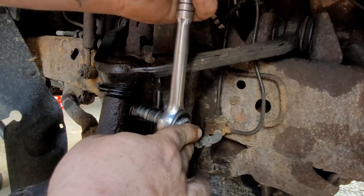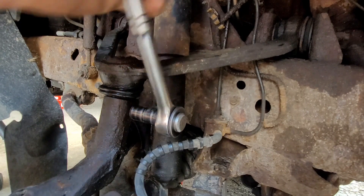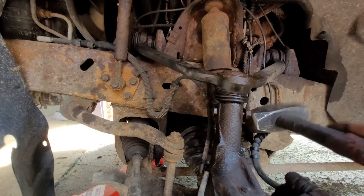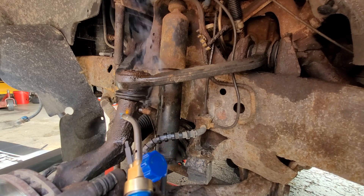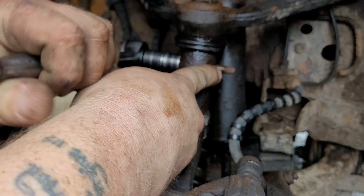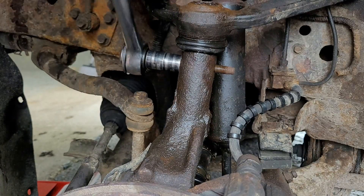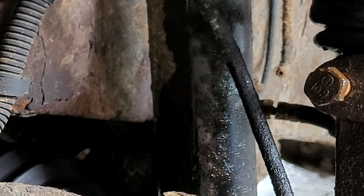We have another job besides the brakes — we're gonna take off the upper control arm. Grab your 15 millimeter socket and break this loose. This is a pinch bolt, so you want to knock that bolt all the way through so we can take off the upper control arm. If it's rusted like this one, sometimes you've got to put a little heat to it. Another thing you can do is put the 15 millimeter socket on this side and try to get it to spin — if it starts to spin, you'll be able to knock it through. Go ahead and hit it with your hammer.